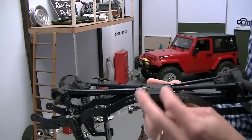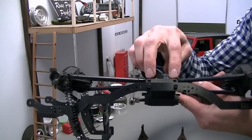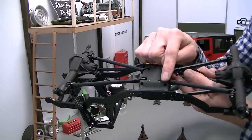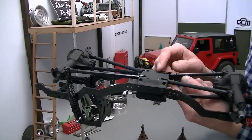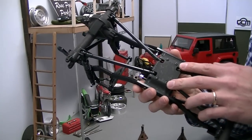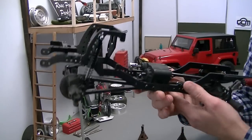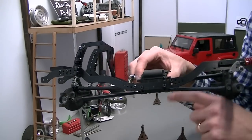You can see here how the bottom links are mounted kind of like an SCX is, where you've got the side-mounted holes below the frame. Here's the bottom of the frame — I have this turned upside down for the light. The center skid has a drop in it. This is from GCM as well, and it's called our drop skid. It has four mounting holes for our one-to-one transfer case or for our brand new high-low transfer case, which is a two-speed unit. This drop skid lets us lower the links a little bit here at the bottom.